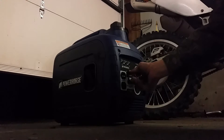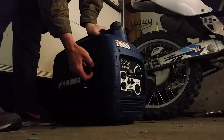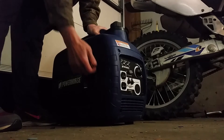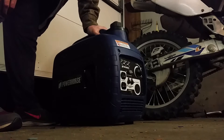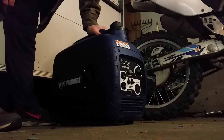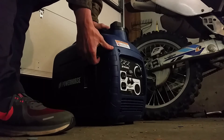I'm gonna have a follow-up on here and I'm going to turn the eco mode off. I've moved this over to choke mode. I ran this for a whole weekend and I haven't changed my oil yet. Just to kind of re-prime things, I'm gonna do a couple of soft pulls on choke, and I've opened my vent cap here. I haven't replaced my spark plug yet but I've cleaned it probably about three times in my general inspection and it's looking pretty solid, except for just needing to clean it occasionally. So let's see if on this 25-degree day she'll start for me.